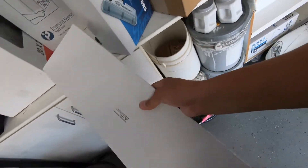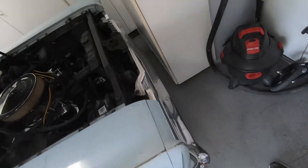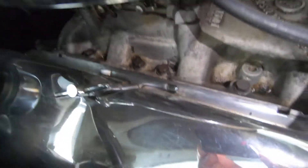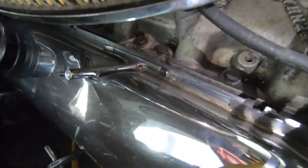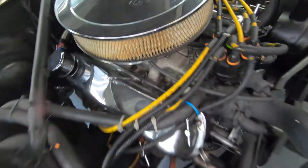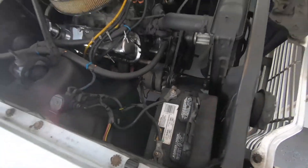I ordered new gaskets too, so it's gonna be brand new gaskets. When I first got the car and parked it in my garage, I noticed down in there that there's some wet oil, so I'm thinking these valve covers actually have a small leak — the gasket is leaking oil onto the engine. I had to put a little piece of cardboard down at the bottom because there are some small leaks. I found out the fuel filter is leaking, the oil filter has a small leak, and a little hex nut that fits into the oil pan is also leaking.